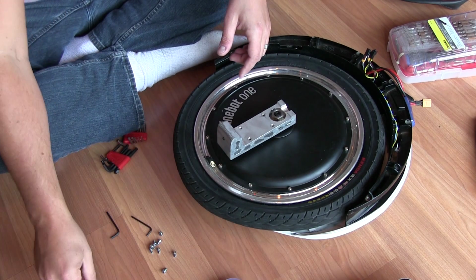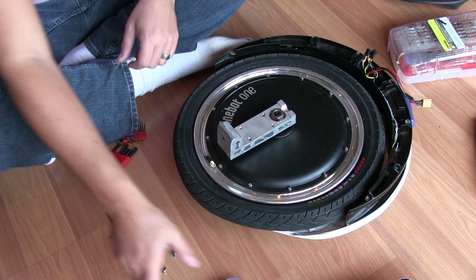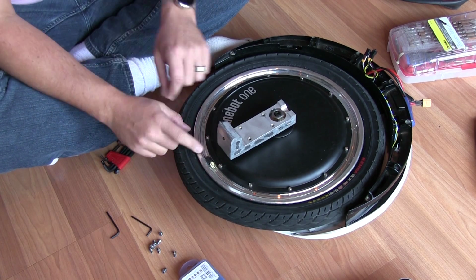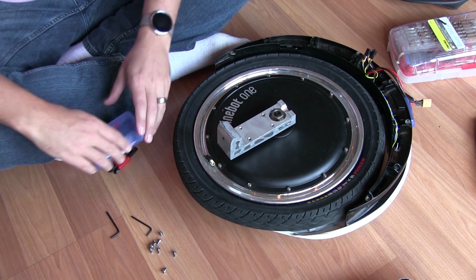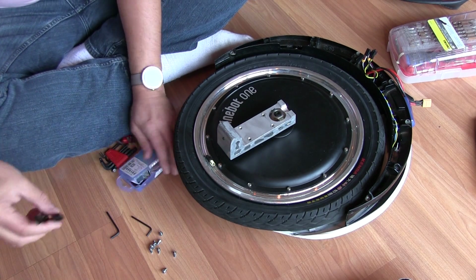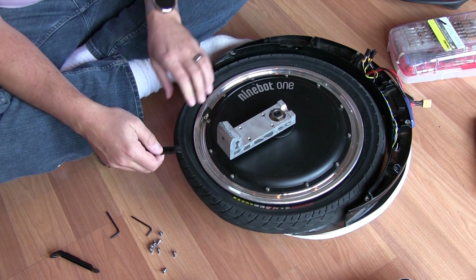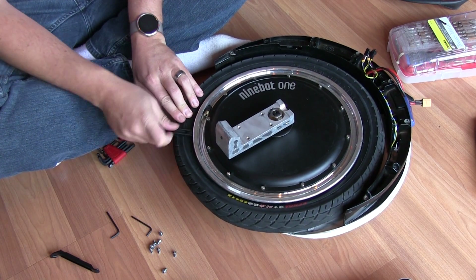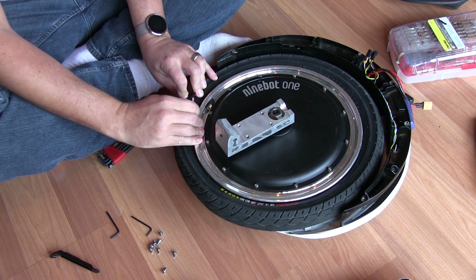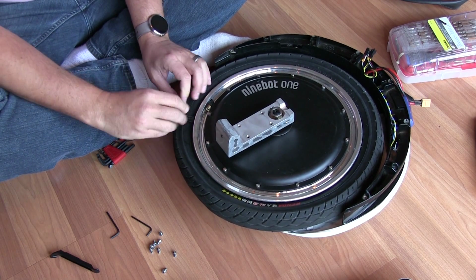And someone might be asking, why did I actually go out and buy another tube when I could have just patched it? I do have a patch kit here. The compromise in my tube wasn't the actual tube. It was the stem itself. I took it down, not the valve, but the actual stem, and it appears there's a little hole or a puncture. I took it down to the bicycle shop, and they verified, sorry, this isn't something that can really be reliably repaired. You're better off just buying another tube, which they didn't have, and I had to order one online.